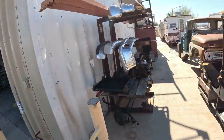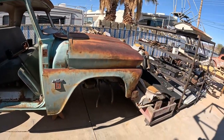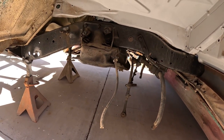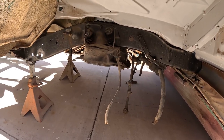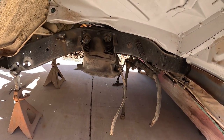I already took it off the vehicle. A while ago I bought this really just for the sheet metal. The missing pieces are elsewhere around here. But for those that didn't know, 63 on up Chevy truck - this gen and the square bodies - the cross members and suspension pieces are really all interchangeable. And I know it says C10, but when I bought it it had a completely rebuilt C20 chassis under it. At the time I didn't care about the chassis, I just wanted the sheet metal. So the disc brake front end.